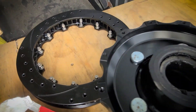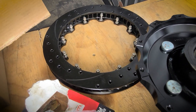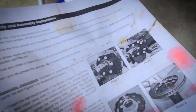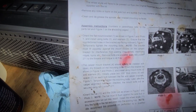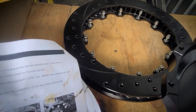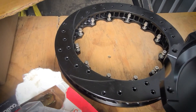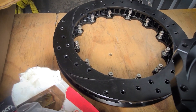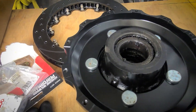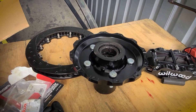So we're going to get the rotor on here — it lines up with those holes. The manual says something about inch pounds; I converted to foot pounds because I'm a dumb American, but it comes up to 13 foot pounds. Red Loctite, star pattern on the tightening sequence. That is a 5/16 12-point socket. And then the rotor will be attached to our hub and assembly, and we can get to centering everything up and getting it on the car for good.